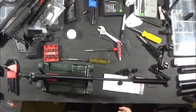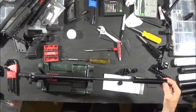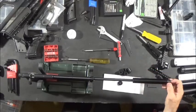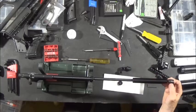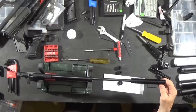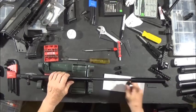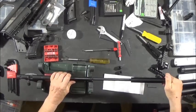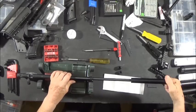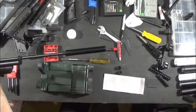And now you have your parts. And it gives you extra. It's really kind of nice. And there is a spring. You take the spring, you put the spring in first. Then I'm going to slide in one of the silencing cups, two of the silencing cups, three of the silencing cups, four of the silencing cups. And now I'm right flush with the end and I can feel the spring pushing. So I'm just going to push that spring in a little bit, that holds everything into place, and tighten it down. And that's basically it. Now I really like the way that looks. Nice and clean.